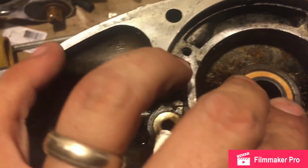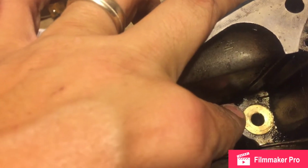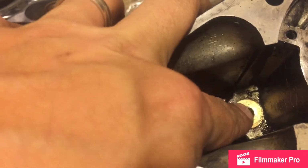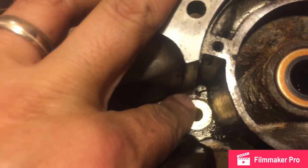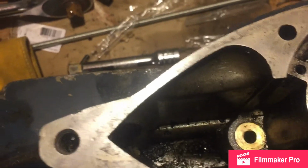I put the new drive shaft seal in there. I've put, like I explained, the plastic gasket first. The O-ring fit inside the bushing. Bushing is pushed down. I used a socket, like a 12-inch long socket, about within it. It's flush. It's perfectly flush. The shift rod will then slide right through it. That's over here. So we're done sealing the lower unit.